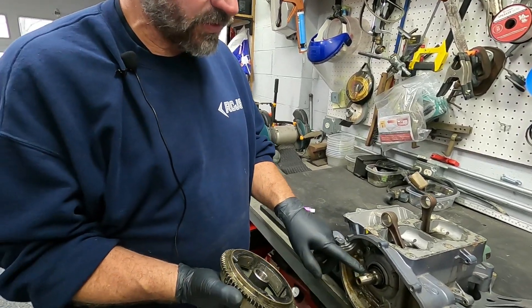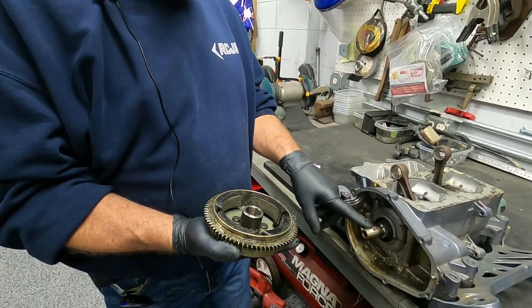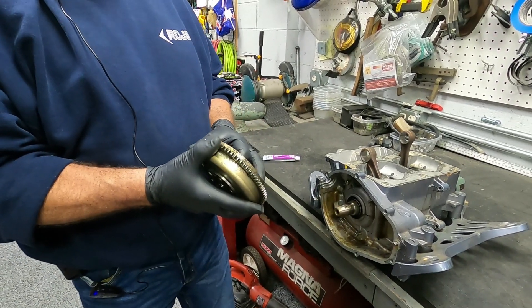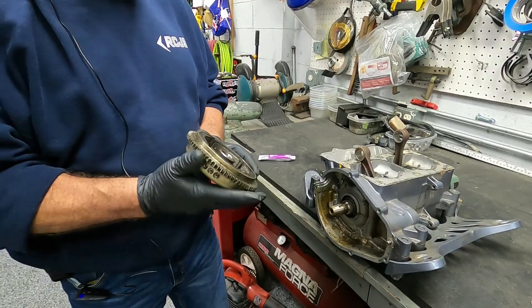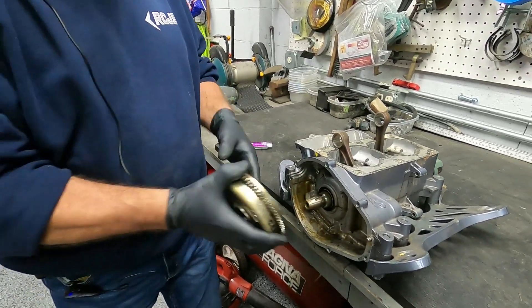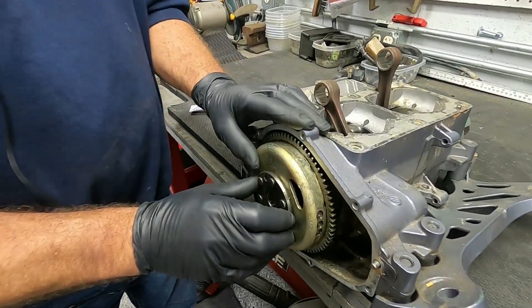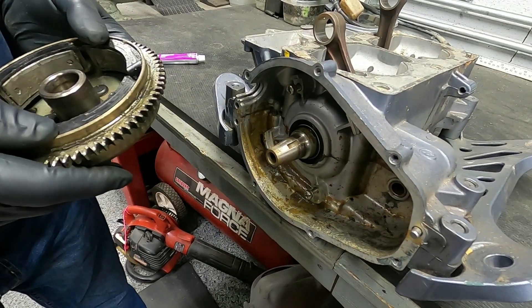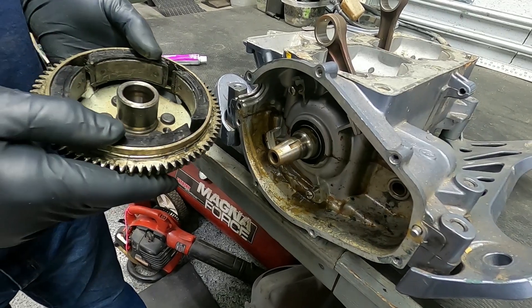The flywheel fit to a crankshaft is an interference fit. It's a tapered fit — it goes on and when you torque it down it gets wedged on. There are some misconceptions that I see all the time on the internet talking about a flywheel key.